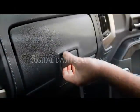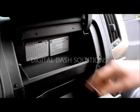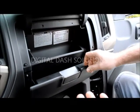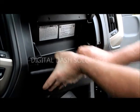Okay. The next step, we're going to take out the upper and lower glove box. I've already removed the screws to make it easier. There's one here, one here, one here, one here, and one on the bottom, another one on the bottom. Tahoe's may be a little bit different. Once the 4 screws are removed, it just snaps out of place.